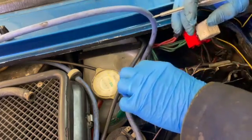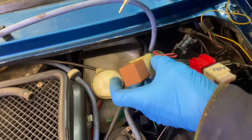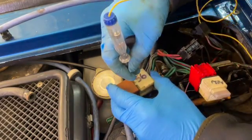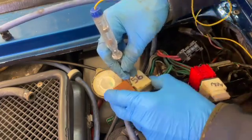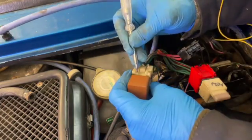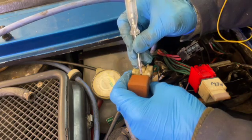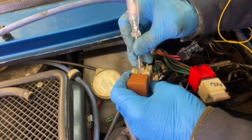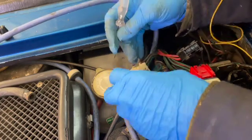The power goes down the green wire to the fuel pump relay. You can see that there's life at all the contacts. It goes to the ECU, and when it chooses, the ECU will earth that end of that wire and close the relay contacts, powering the fuel pump.